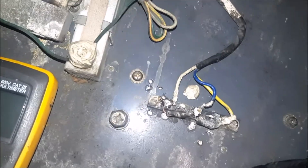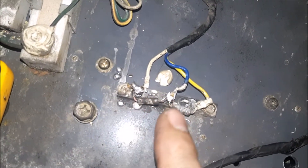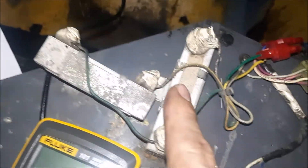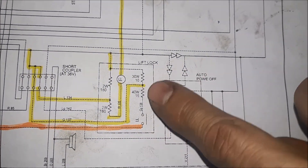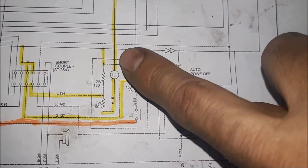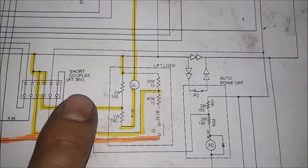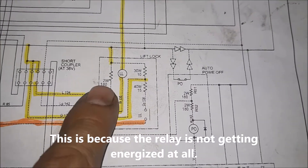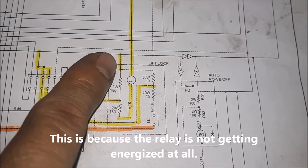You can see a couple of resistors as a dividing network. You have your 2-watt resistors here — somebody was already toying around with this one before. The bigger resistors are going to be around 30 to 40 watts, and the smaller resistors are the 2-watt ones. Both resistors are rated at 180 ohms.